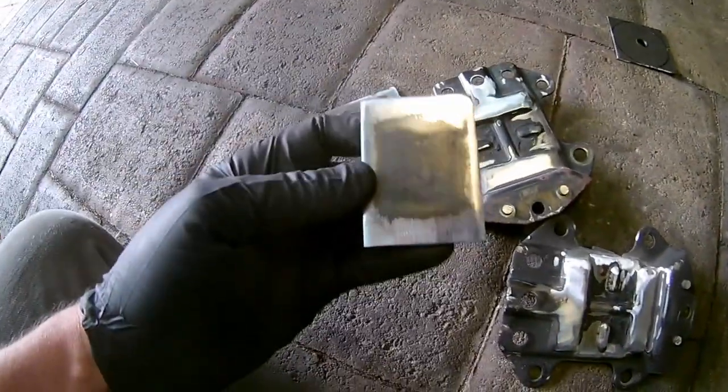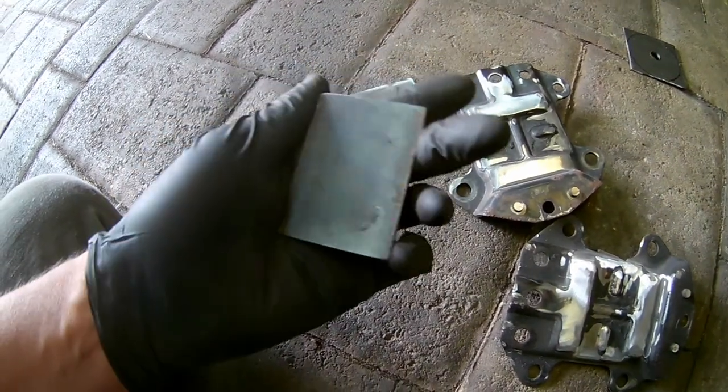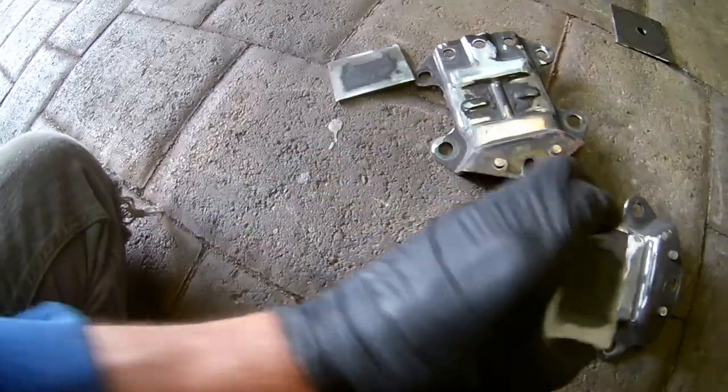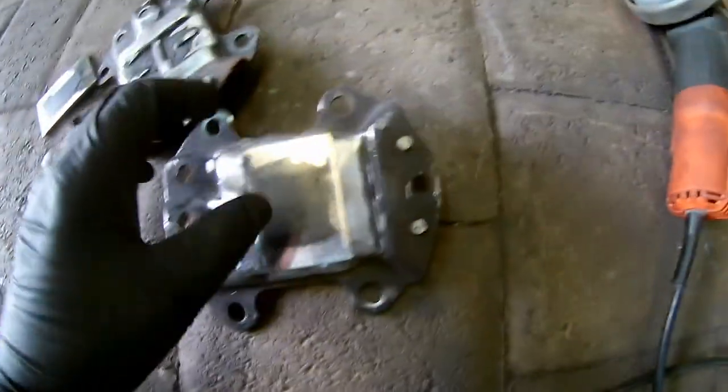I got my little plates cut out and got the mill scale - I mentioned that a little bit earlier, but you don't want to weld to that. So I'm going to put these plates in like that and weld them up.